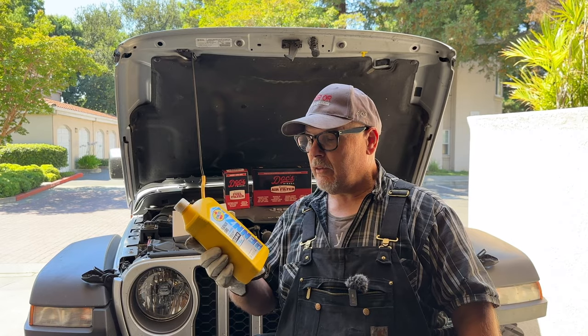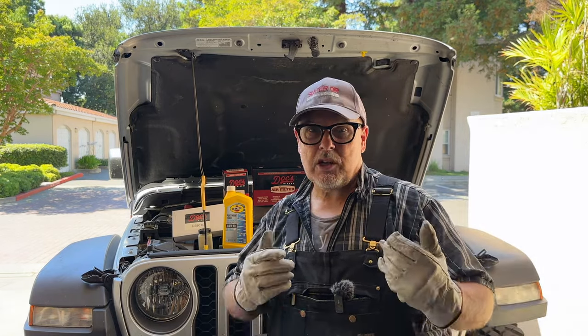I got this oil from Amazon. Let's get going. I'm going to start off with changing the oil, so I'll get underneath and take the drain plug out and let the oil start draining before I do anything else. On the Jeep Gladiator EcoDiesel, it's a 13mm socket to take that plug off. It's got a pretty large pan — 9 quarts of oil in here — and when you take that plug out, it's really going to come out fast, so you can't just have a shallow pan.